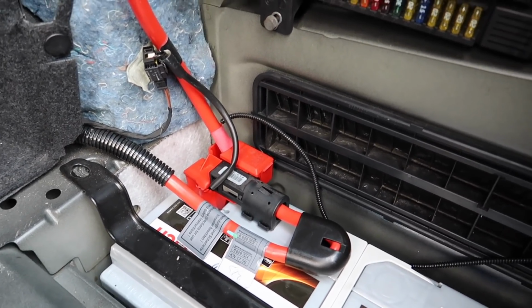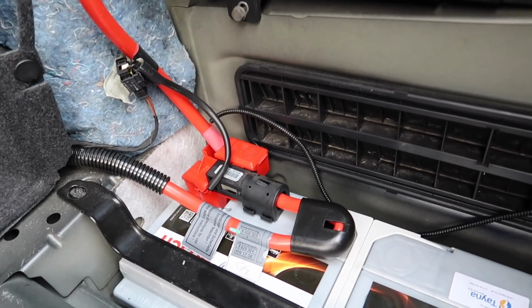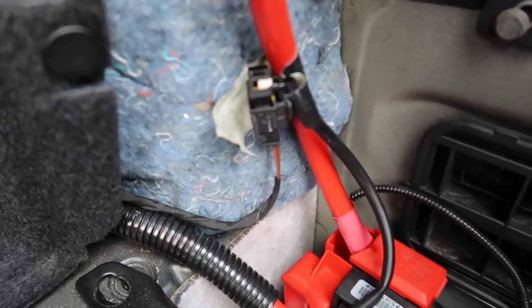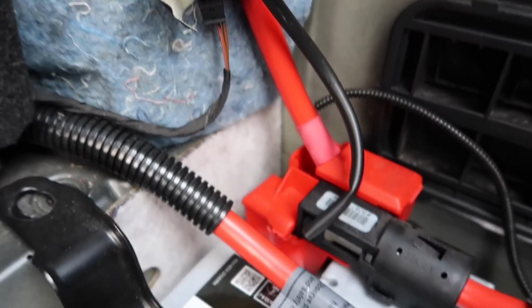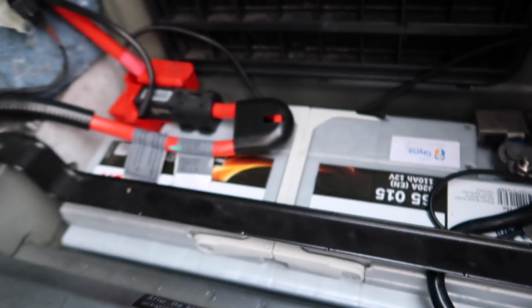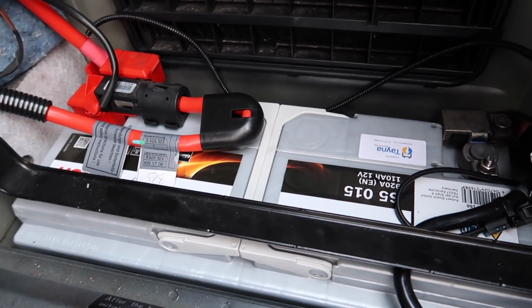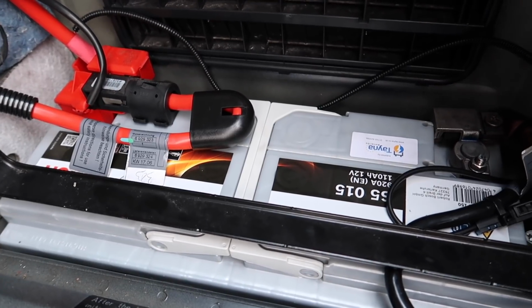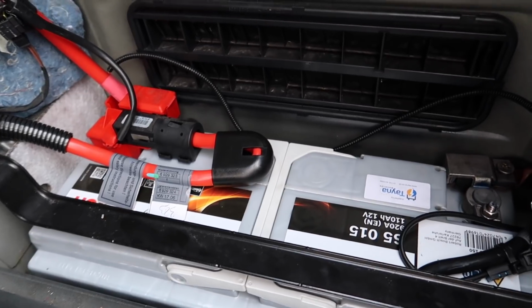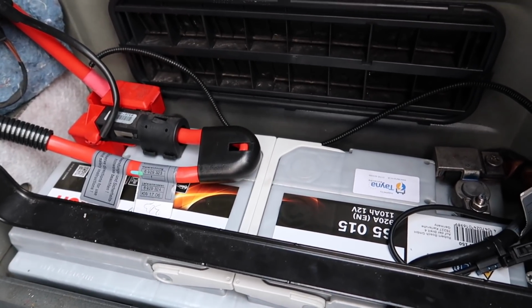That's fine, just make sure you get it replaced, because they do fail, especially, as I said, on the years 2003 to 2005. It runs from there, as you'll see, all the way along the battery to over here, then up here onto that blue wire, and that's the one people usually disconnect right there. So just make sure you do check the IBS sensor and get it replaced if need be, because like I say, the battery needs to be known, the battery registered to this car, so does the DME. Otherwise you will get other electrical faults if that one goes out.